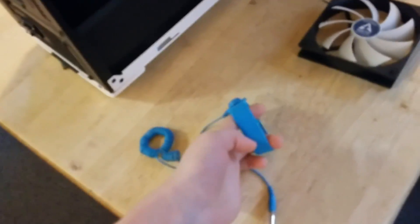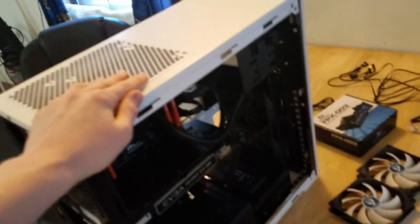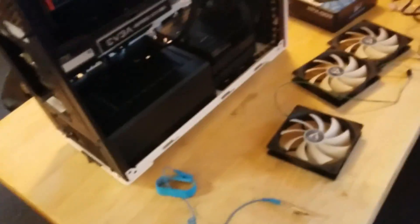Once I get everything plugged in, I'll be back to show you the moment of truth. I was going to say one other thing — this right here, you don't need this. But for me, when I have a $3,000 computer, I just want to play it safe. All you need to do is ground yourself, touch your computer, and maybe wear some shoes. I double it up because I don't want to take a chance of sparking my computer and a little spark burning everything. Also, having two different sized screwdrivers will be your best friend when working on a PC. I didn't install the temperature wires because I use CAM to do that anyway.